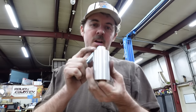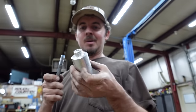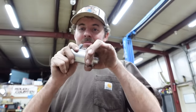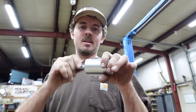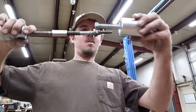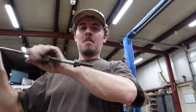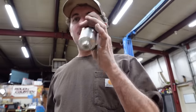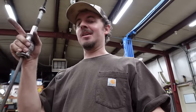So it took a little longer than I was expecting, but now if you can see, it's tapped. It's probably gonna get stuck in the end of the crankshaft, which is cool because it's tighter tolerances there. Now I got a bolt and I'll thread it. Hopefully I won't need it, but this is called a slide hammer. I'll weld the bolt to something that threads in there and then get it out. I gotta get the end of the crankshaft cleaned up.